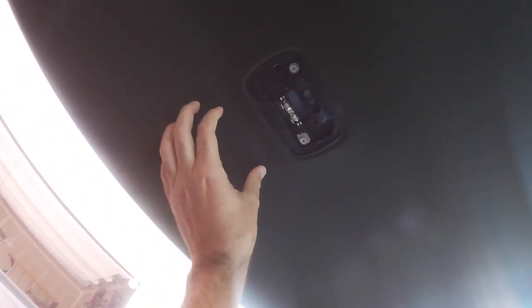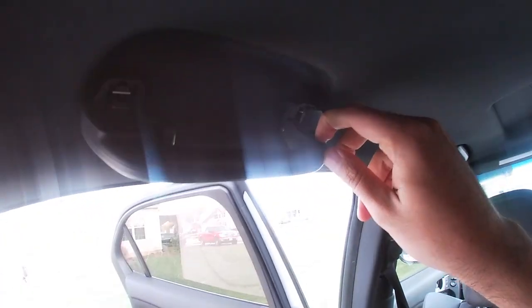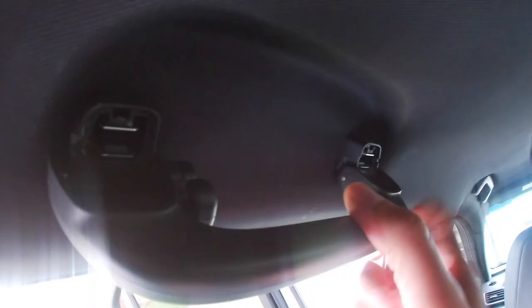In order to do this I need to take the roof out. I took the light cover out, so I'm going to take these two screws out and prop the light out, take the whole assembly out. The antenna sits right about here and you have to be very careful because if you lean down on these you'll bend it — there is a little bow for your sunroof as well. There are these clips in here so use a trim tool or a flathead screwdriver. Pull these out and then the whole thing comes out — same thing on the other side.